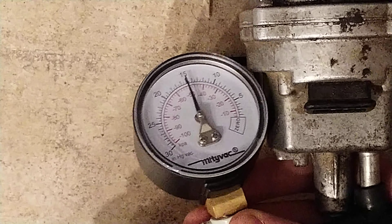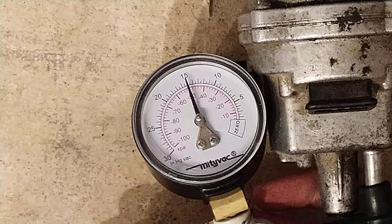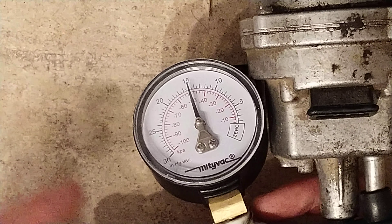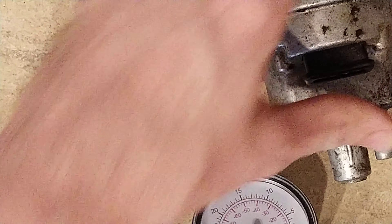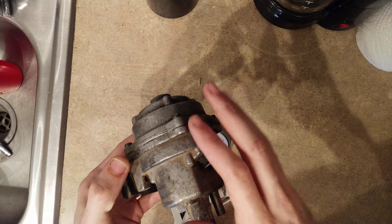I'm at 15 now — we count one, two, three, four, five, six, seven, eight, nine, and ten. As you've noticed, it's still at 15, so this is a very, very nice pressure sensor. If it started dropping off within 10 seconds to 13, you have a small tear. Right now this looks to be in fantastic condition. I just released the vacuum here with the little plunger at the bottom — this sensor looks to be absolutely perfect. We'll install it on the car.